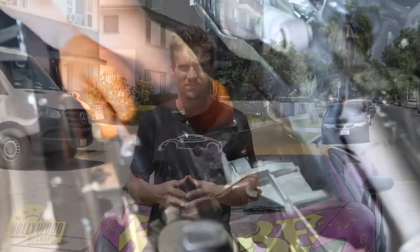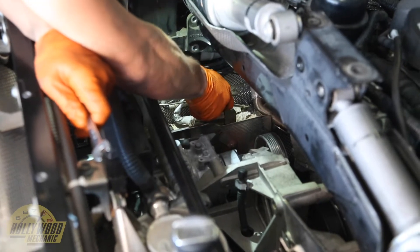Just something to remember when you're working on these thermocouples or the exhaust gas temperature sensors: make sure the car is completely cold — it hasn't been driven for like 20 hours — because if you have any temperature at all in that exhaust, it'll bind up the teeth and you're going to strip the threads on the cats. And that is extremely difficult to fix. You probably have to remove the cats. The heat causes them to seize into place.